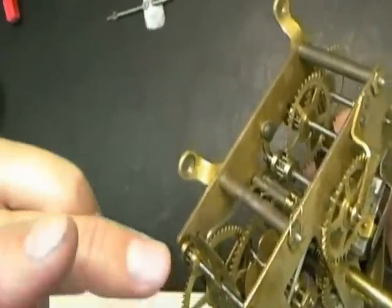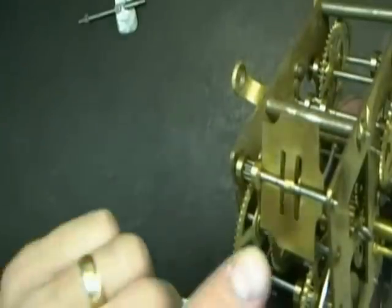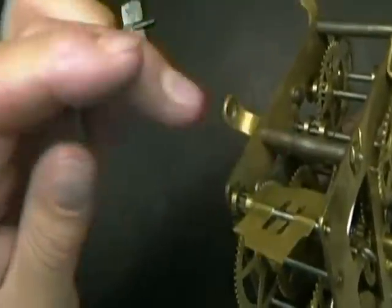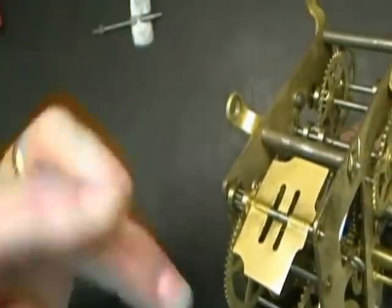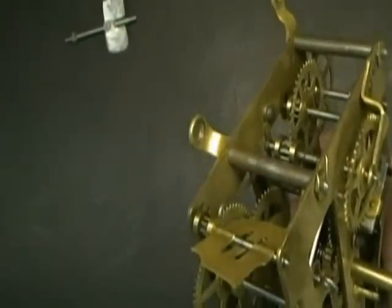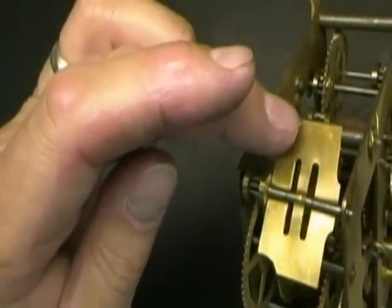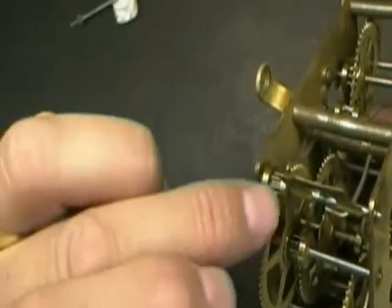In case you did not know about fan governors and what reason they exist — here's another movement with a working fan governor. You can see it's just a piece of brass hooked on with a little strip of brass on each side, and it's allowed to turn on that arbor with just a little bit of resistance — it can slip. The reason they put it on there is two-fold. One: when it spins, the faster it spins, the more air it moves and the slower it wants to go — it acts like a brake, so it doesn't go gung-gung-gung; it actually goes bong, bong, bong the way it should in a pleasing way. The second reason it slips: it should slip easily enough that when the train comes to a complete stop suddenly, even though the fan is still moving at speed, it's allowed to slip until it can stop without shooting all of that stress down into the wheels and causing the wheels and pins to break.